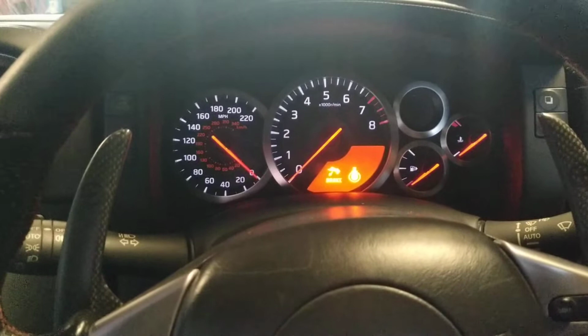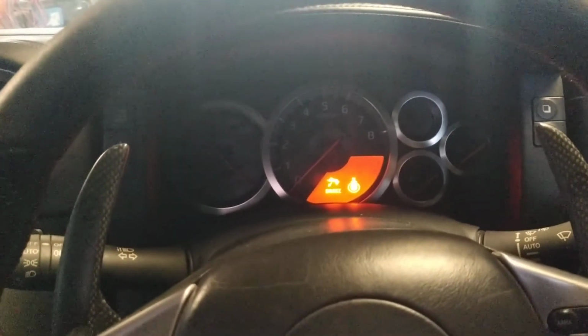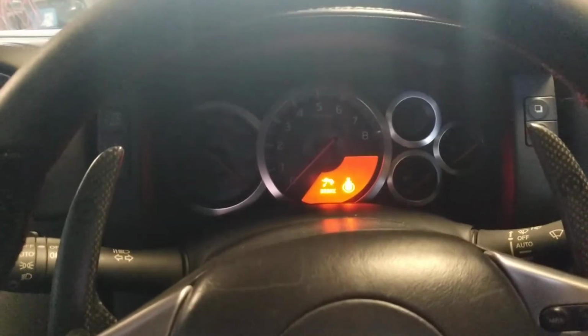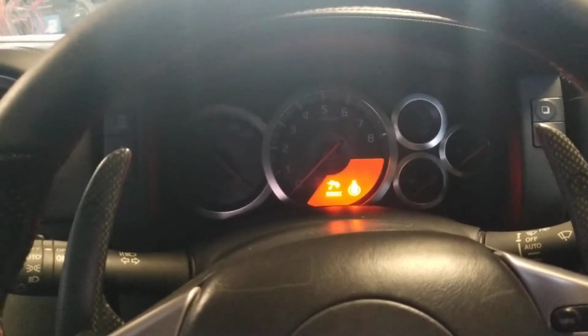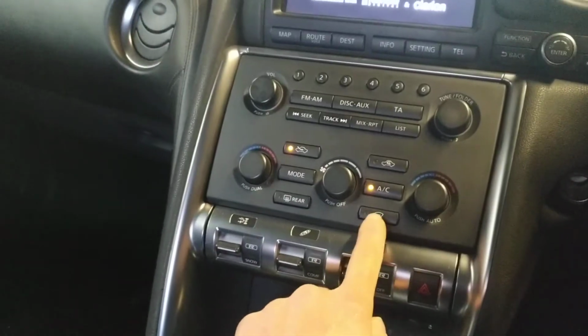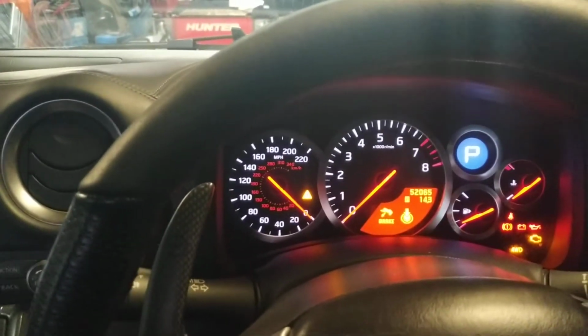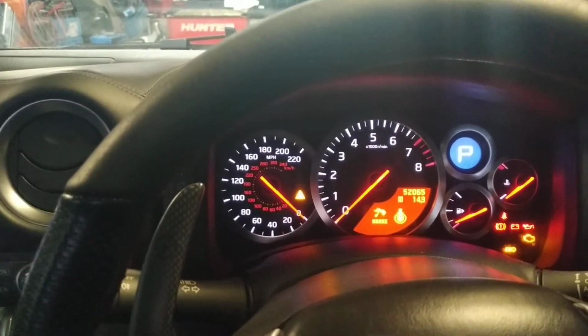Also, this has the capability to put it into valet mode, so if it goes for a service, you can place it into valet mode. The way you do that is ignition on, wait about 5 seconds for the CAN to wake up, insert your push sequence, so 1, 2, 3, 4, double flash from the indicators, there you go.